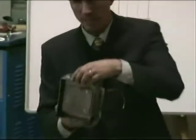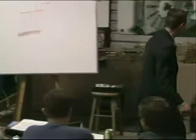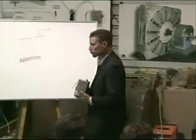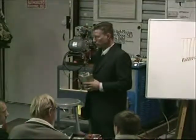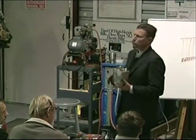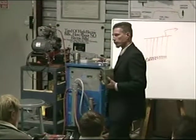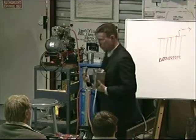So, you know, kind of get an idea of how the plates are spaced. So if you're going to drill and tap and put screws in there, you know where. Outside, you guys use clamps on the two cars outside. Yeah, you can use clamps instead of drilling. Some people just want to get the job done, know that it's safe, and get it out, and they would use clamps. Some people want it to look fancy, so they'll weld to it, or they'll drill and tap and more securely mount.